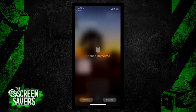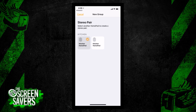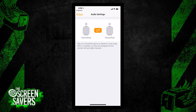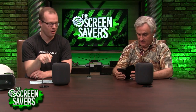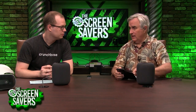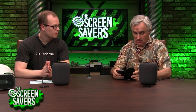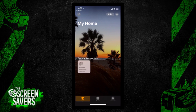Now I'm going to pair them — let's see how hard that is. We force touch one of them and select Details. These are all the settings, and here it is: Create Stereo Pair. I'm going to select another HomePod. Tap on a HomePod to identify it and swap them if needed. That's the right one and this is the left one, so we have left and right. Now I only have one icon — Kitchen HomePod, left and right.